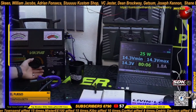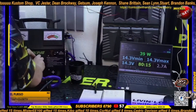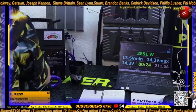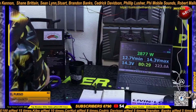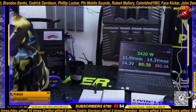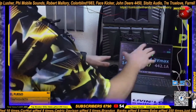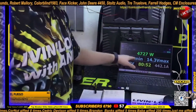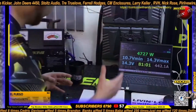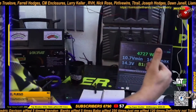Let's just do it with the AGM battery by itself. I'm going to do a slow roll because I want to show you guys this. We're going to go right past what the alternator can do — because everyone wants to add more batteries for higher voltage. Once you go over, look at that — I'm down to 12.8, just dropped. Now I'm getting into the battery. It can take a lot more and still stay around 11 volts. These AGM batteries are great for starting a car — they rate crank amps below 10 volts, that's where you get 800-1000 cranking amps.